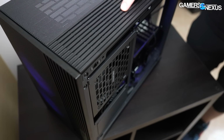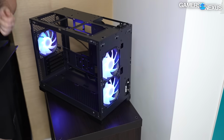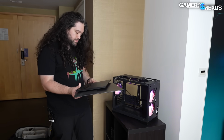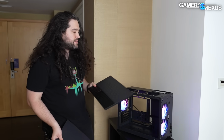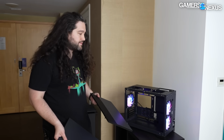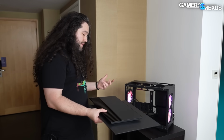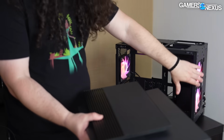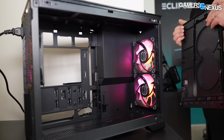Now, power supplies we don't currently test thermals for during our case reviews, but I think I might want to start. We could run a thermocouple to some of the components or something like an APFC FET. They are tested in very high heat conditions, typically 50C for standard testing for 80 Plus or Cybenetics, and that means they can take a lot of abuse. So my level of concern for this is not nearly as high as if I saw this in front of an intake fan for the rest of the case, but I was just thinking, maybe we should test some power supply thermals.